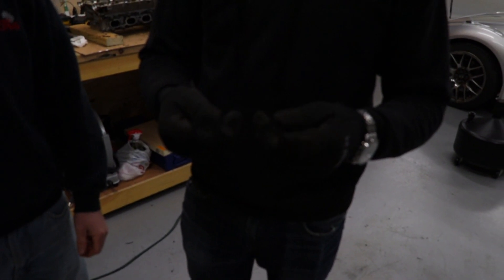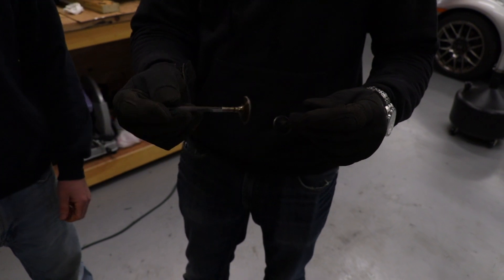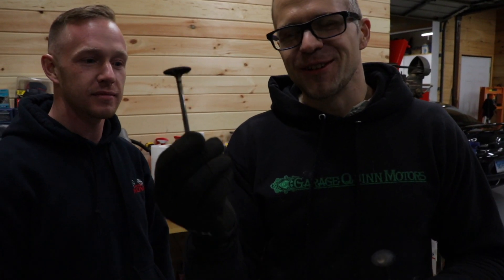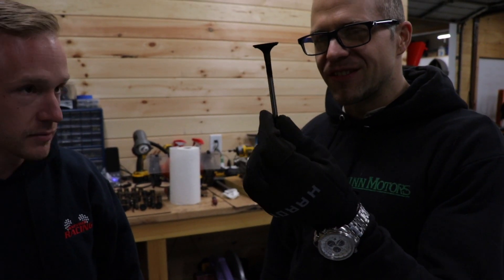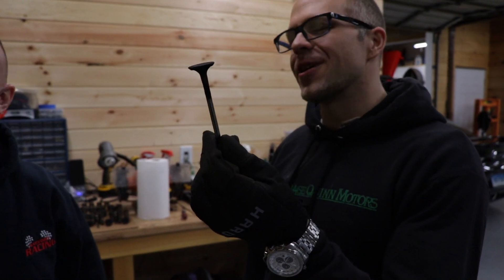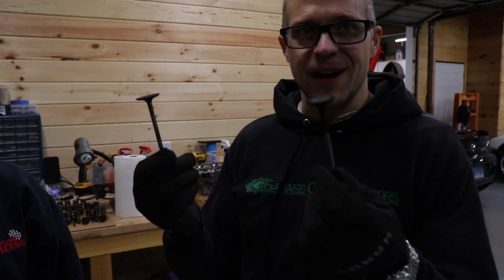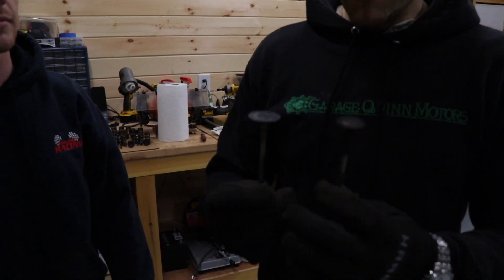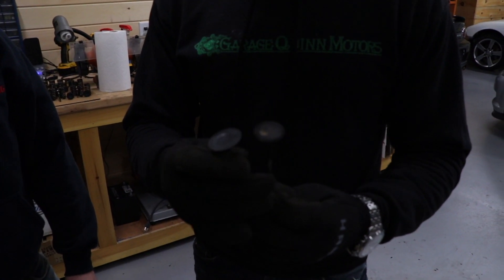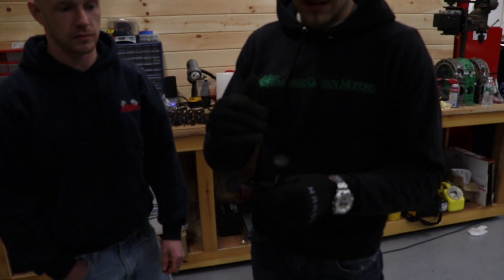So here we have two valves. One is intake, one is exhaust. You can tell them very easily by the size because the intake is always much bigger than exhaust. Our intake is much cleaner. Why is the back of our intake valve cleaner? Because when you inject fuel through the intake manifold, it cleans the back of the valves. When it's burning up and there's exhaust coming out, there's no fresh fuel getting sprayed on the back. This is why direct injection engines have a lot of carbon buildup — because you're not spraying fuel on the back of the intake valves anymore. So they spray walnuts on it to clean them off, but we're not going to do that. We want to get the carbon buildup off because it adds weight and could make the engine more prone to detonation if some of the carbon gets hot spots on it.